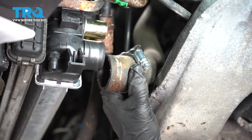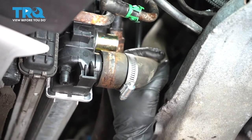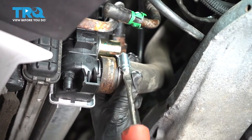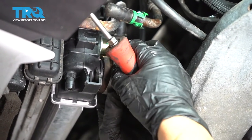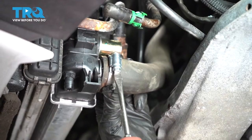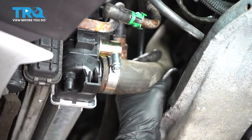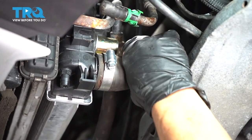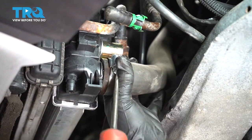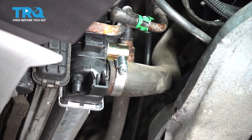While we're down here, before putting the cooling fan in, I'm going to put the lower radiator hose on — makes it easier. We've got a new clamp since the other one was completely destroyed. It's either a flat blade or an 8-millimeter socket. Always snug it up with the 8-millimeter to make sure you get a nice grip. Make sure the hose goes all the way to the end — you'll feel the indent — and make sure you have hose showing on both sides. Then snug it right up.